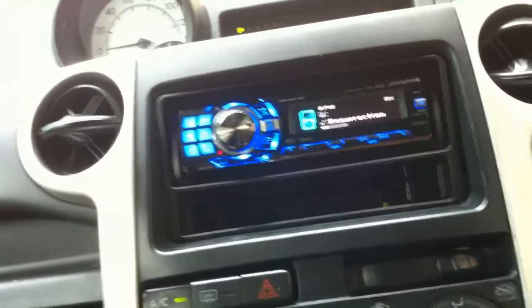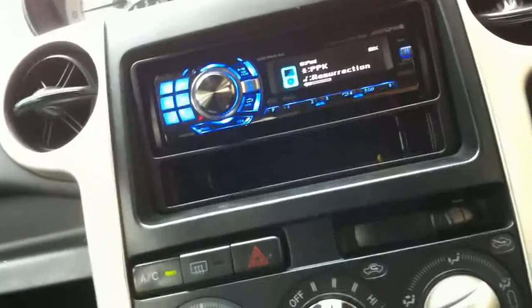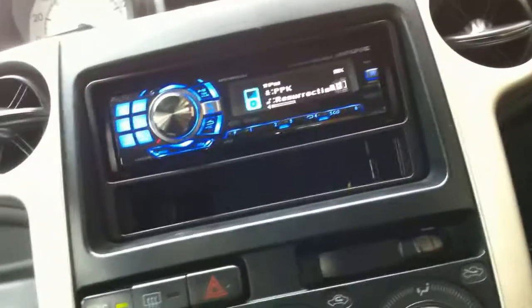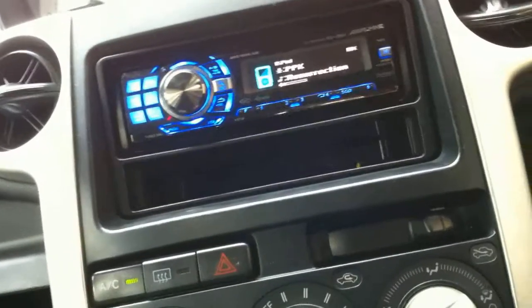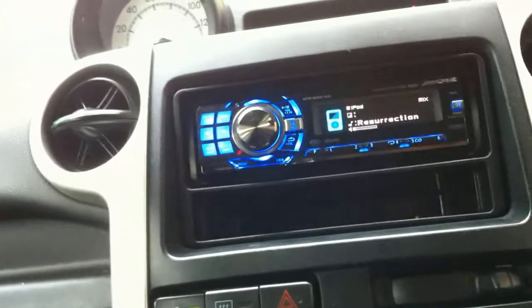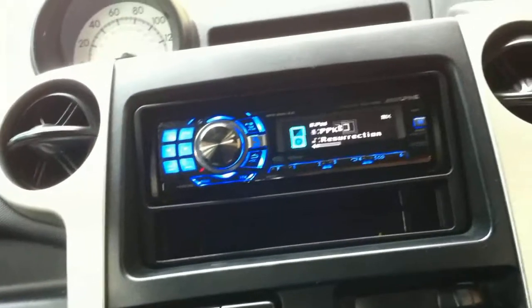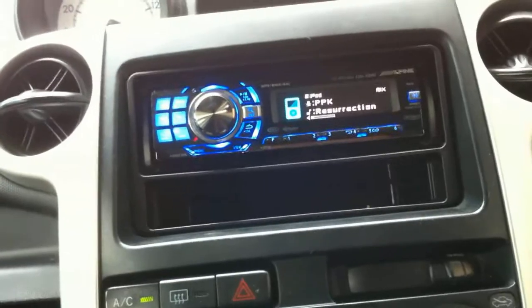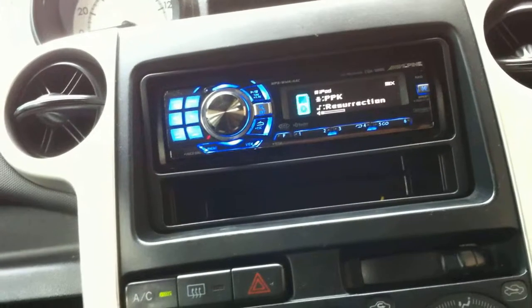Hey, this is Ken, just a quick update. I was having ground noise issues. I've connected the grounds from the head unit, the imprint unit, and the harness to some metal behind the head unit, but I still have ground noise. It's not as bad as it was before, but it's still there. The grounds in the back are connected to the frame and the battery back there, so I'm not sure — maybe I have to find a new ground in the back.